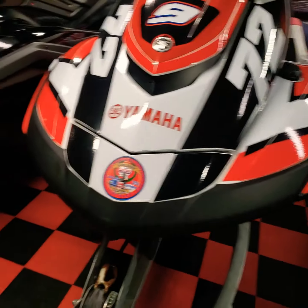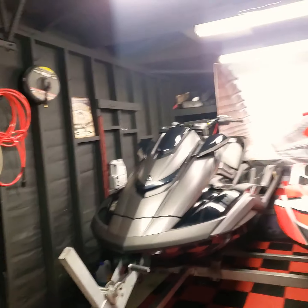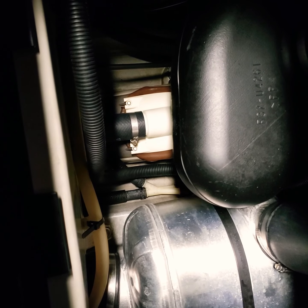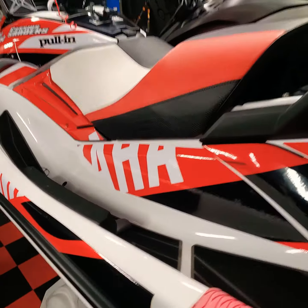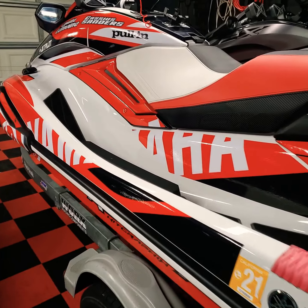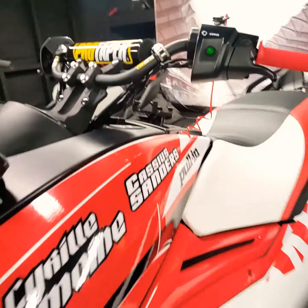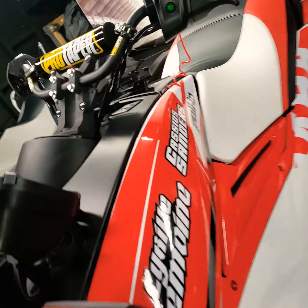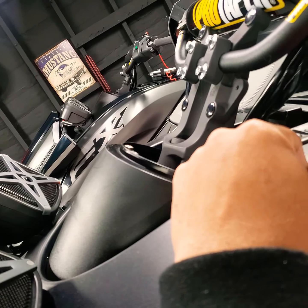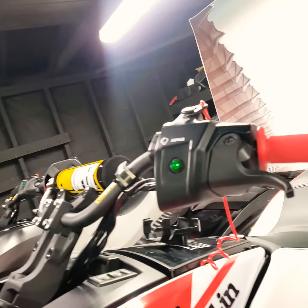I don't go all out on the skis like we did early on. I like to ride more than I like to tinker. I don't need to go over 70. But what we do here — if you see that Y-fitting, it's got four inlets. One of them is restricted; that goes to the engine and cools it. Riva makes a kit where you just drill it out for a little more water flow — this is for the racer on a budget. I like the race handlebars, but they're kind of expensive, like $600 bucks. I just use the factory one and get some handlebars and call it a day.